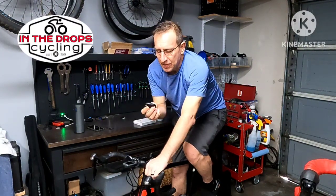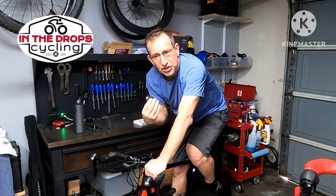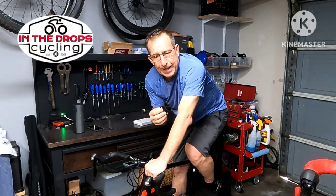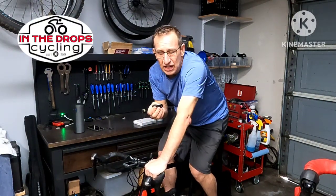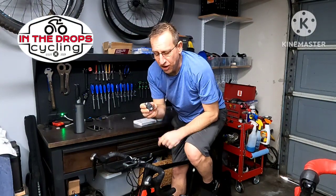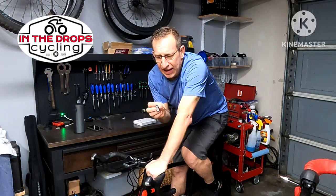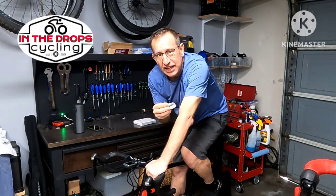But this new one had a little problem — it started leaking and stopped working. I thought it was the strap at first, since sometimes the little wires in the strap go out, so I got a new strap. But it was still having problems; the battery was dying pretty fast. I finally figured out that the seal inside the battery compartment was bad, it was getting full of sweat, the battery was getting corroded, and I could squeeze it and sweat would drip out. It was nasty.